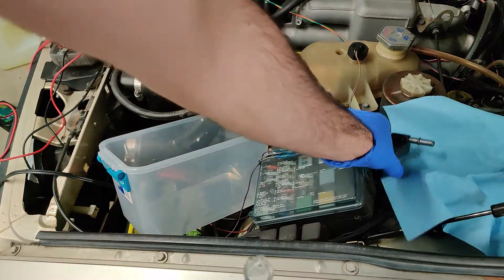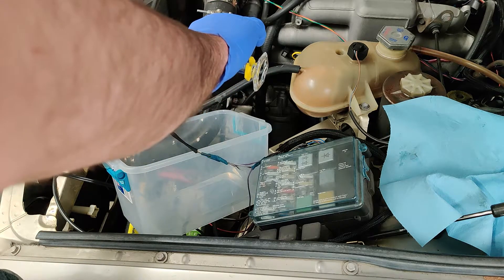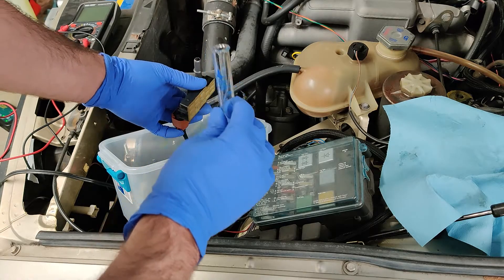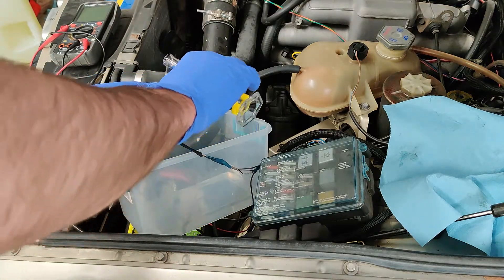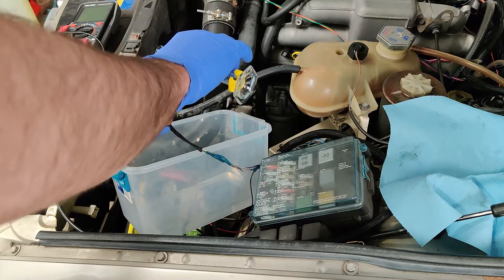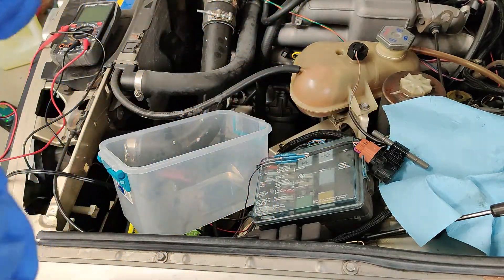10% methanol with the 91 octane — which already has 8-ish percent ethanol. Showing 17–18%, bouncing around right in there somewhere. Let's try it one more time, give it the benefit of the doubt. Yep, 18-ish percent. I spilled some — that one might have been a milliliter or two off, but we're close, and for what we're doing, close is pretty good.